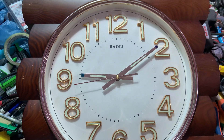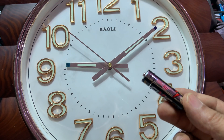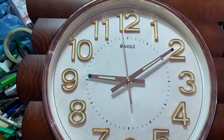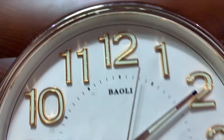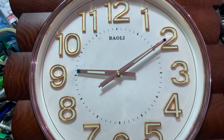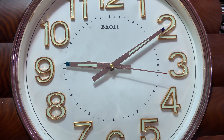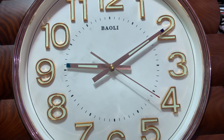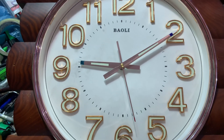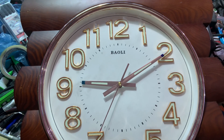Here we are — I've supplied a new battery for the clock. This is the old battery and it's completely consumed; it reads 0.7 volts. Before we start, I'd like to tell you something about wall clocks. The kind that moves continuously is really recommended because that is how it saves the battery. The one that moves with every second is actually consuming the battery faster. But unfortunately, as I said, that's not the case with this clock — but we will solve it.